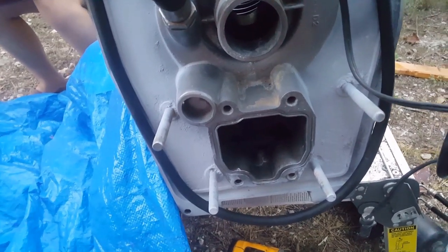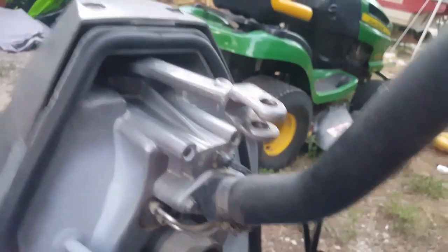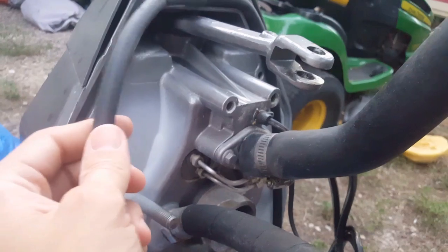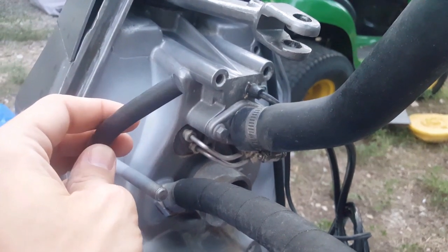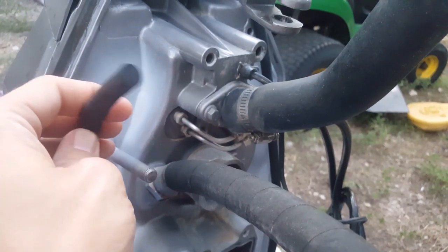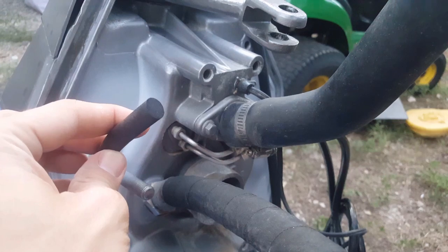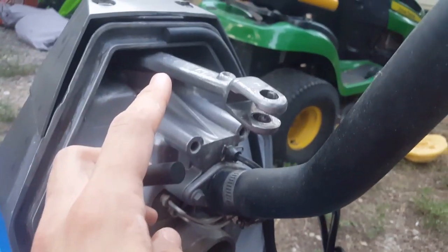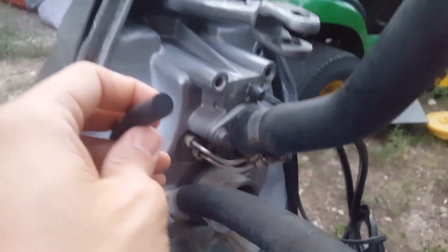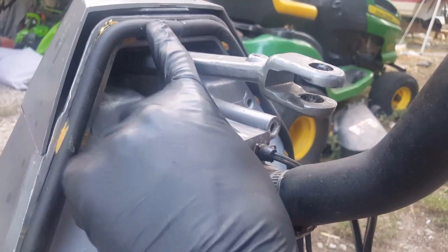If you start those ends over here on the left side, or at the bottom, you're going to have a lot of future leaks. The target is right above the steering arm. Also, this is pretty much a one-size-fits-all transom seal, so you are going to have to cut it to length. You need to be super precise with your measurement on your gimbal housing - if you mess it up there's no real way to fix it easily.